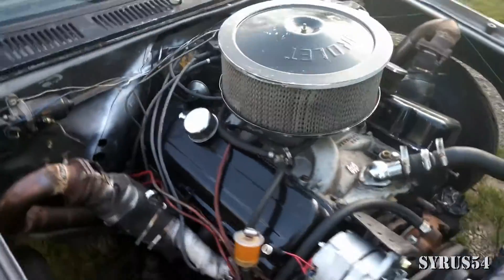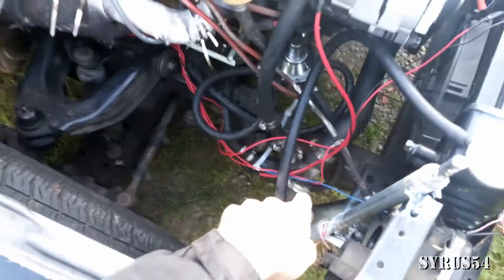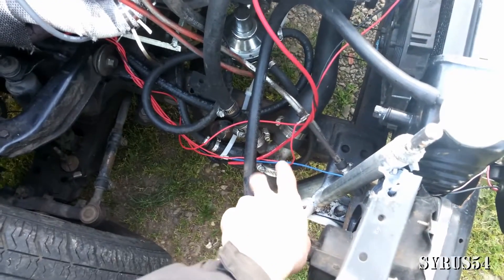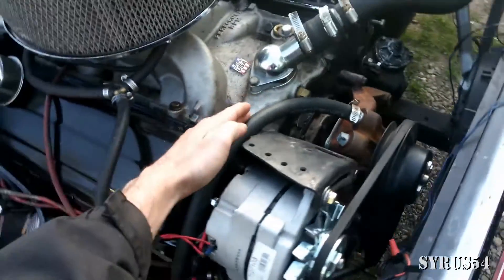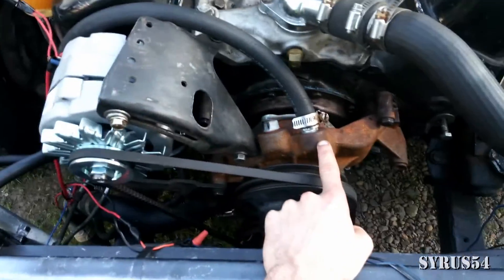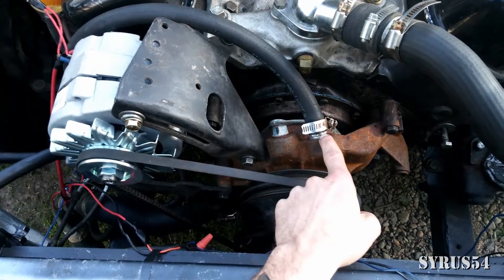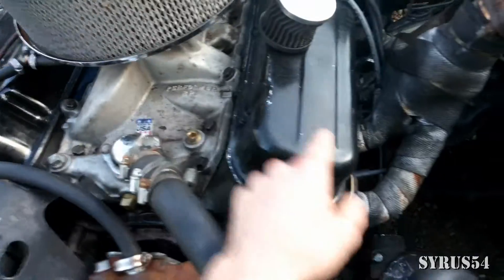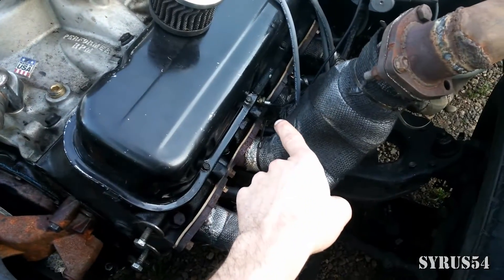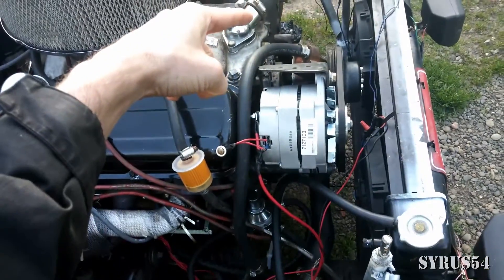I'm going to show you how I've installed mine. From the top of the intake, we have the hose that goes to the top of the radiator. Down at the bottom of the radiator, I've run my own little connector that goes into two hoses. The smaller hose comes over to the top passenger side of the big block Chevy water pump. I've plugged off this connector — I don't run a hose into this one. I've got my temperature gauge down over here. Back to the T-junction, the smaller hose comes off over to the passenger side of the water pump.